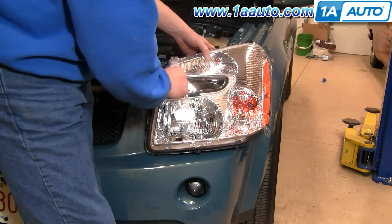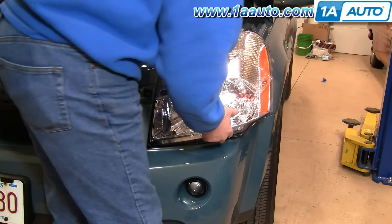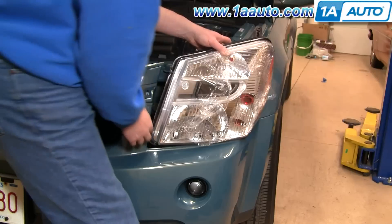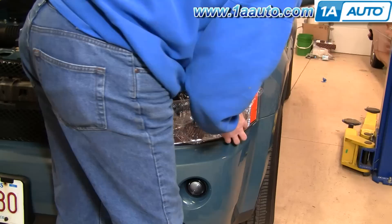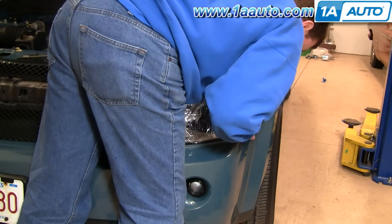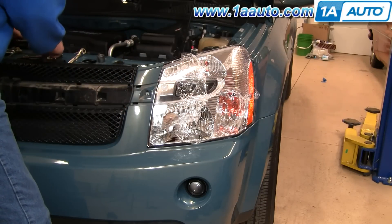Make sure you pull the plastic off the bottom and the sides. Put your light down and in, making sure your wires go down below the metal support here. Pull it on that right there a little bit, then put your light into place. Push the upper one back and on, make sure the lower one gets lined up and goes back and in.